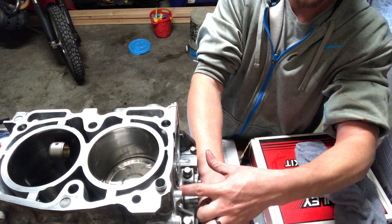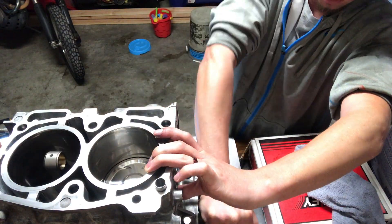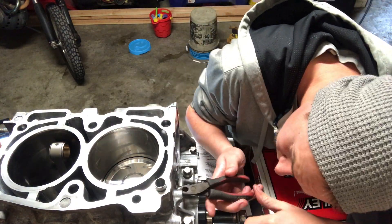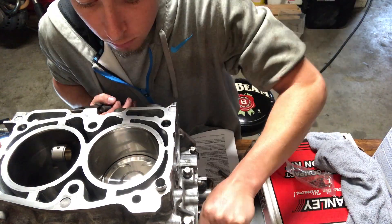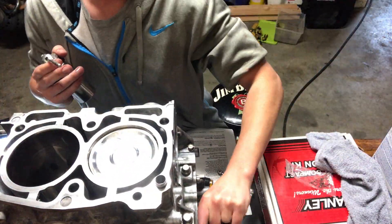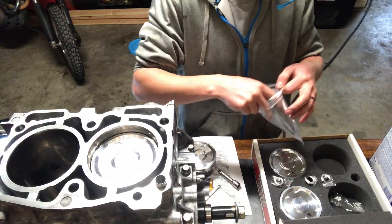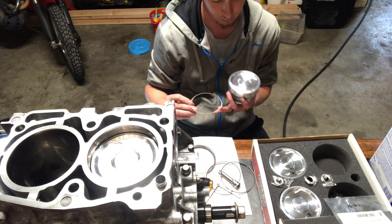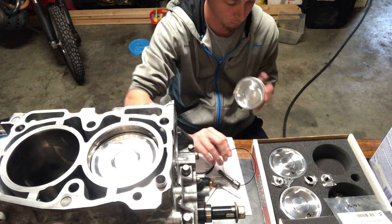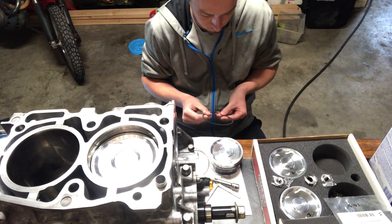This is the hardest part because you've got to line your piston up with your connecting rod and you can't really reach the connecting rod. You can kind of put the wrist pin in but the piston can be cockeyed a little bit so it won't go in straight. So you kind of have to use the wrist pin to bend the piston around to line it up with the connecting rod. Once that's done, put a little oil on the top and move on to the next one. You can move the crank by hand but once you get a couple pistons in there you're going to have to use a wrench — just keep at it.